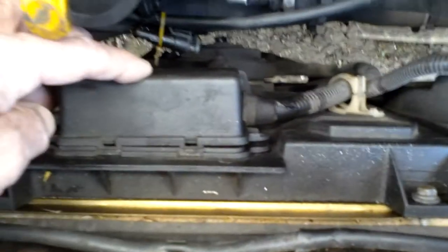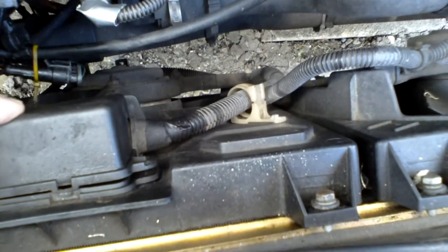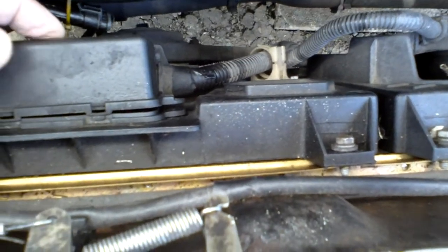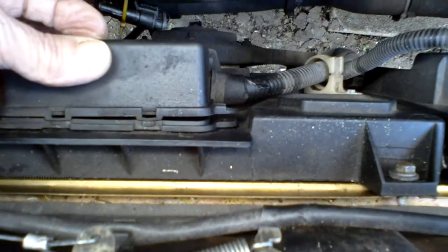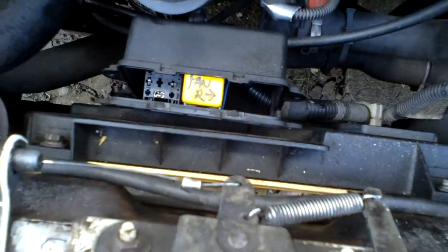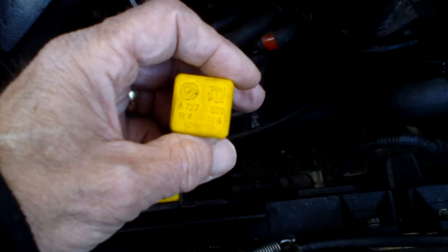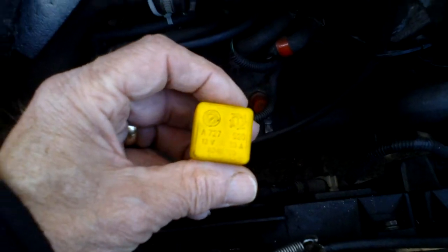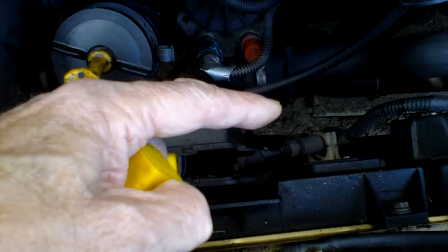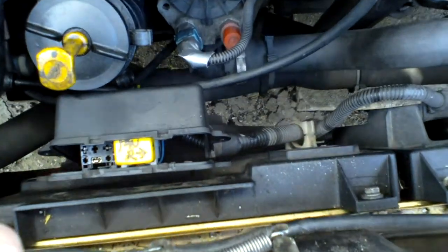There's a box up here which I've got my finger on and you've got cables going into it, which is a good indication that something's happening. The case can be taken off - there's three small screws - and lo and behold, what have you got in here: two relays. They're both exactly the same, they are 12 volt coils and they are 30 amp rated, because these fans when they kick in they take a lot of current, so you've got to have something capable of switching that kind of load.